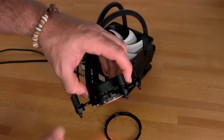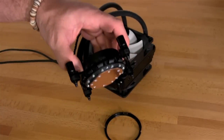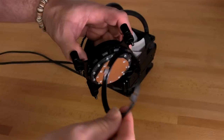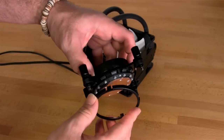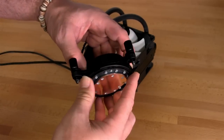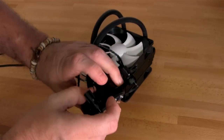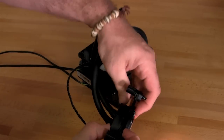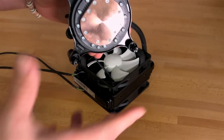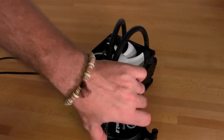We've used this before and it works well — you can just put this in there, sort of pre-mount it, and then twist it around once it's connected to the board, but that can be a pain. One of the things Thermaltake has done to make it easier to take this on and off is they've provided you with a retaining clip. The way this clip works is you just clip it in, find the little spot on the side, make sure it clips in, and push it so it snaps into place at each of the four different locations around the side. You can hear it clipping into place. Once clipped in, it holds the bracket so it can't come off, making it much easier to mount and ensure everything is lined up when you put this on your motherboard.